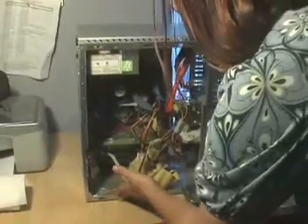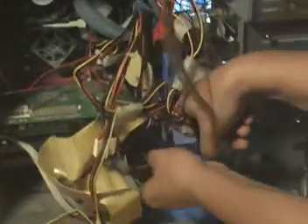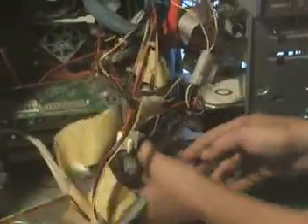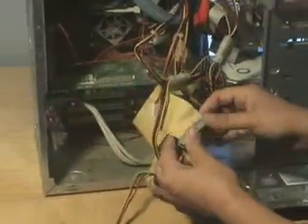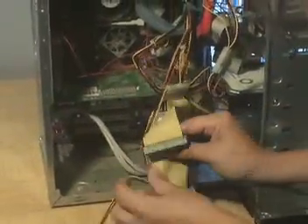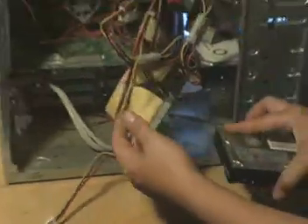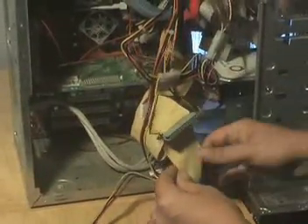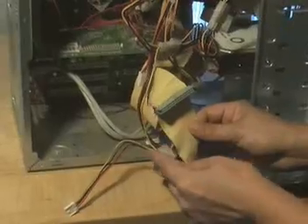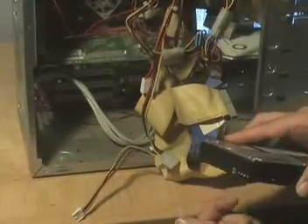The next thing I want to do is set my hard drive down and take a look in here at the current hard drive in the machine. I can see that there's a cable connected to it and it runs out here, and I have the secondary connection on here. Sometimes the cable is actually notched for you to match a notch on the hard drive, which makes it really simple to connect. Sometimes it doesn't, in which case you have to know that red means pin 1, and pin 1 always goes towards power, so you're going to want to put the red side heading towards the power.